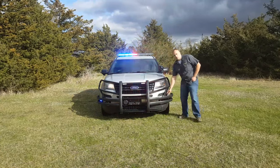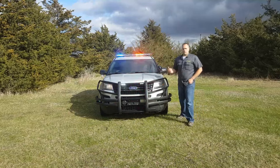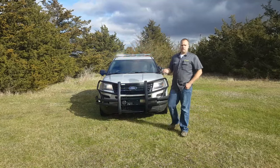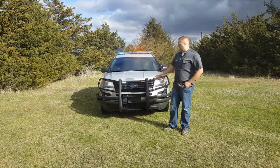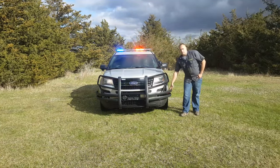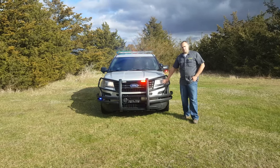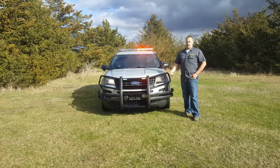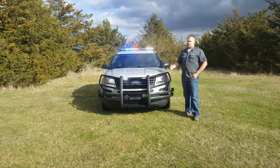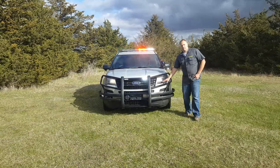They have a double hole brace that goes in the wheel well here, and basically what that allows is you to pit those vehicles without causing substantial damage to those sensitive areas, because most of this is just plastic back here. So without this pit wrap, if you were to pit somebody, you're going to cause a lot of damage to this vehicle. As often as officers are getting in chases, this car is always going to be down if you don't have a setup like this.